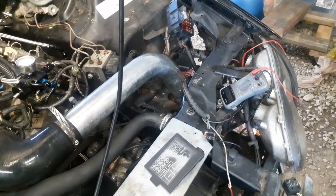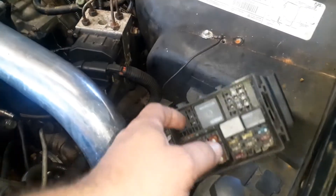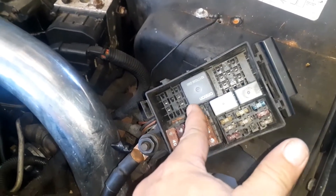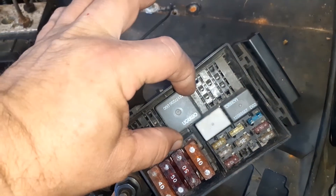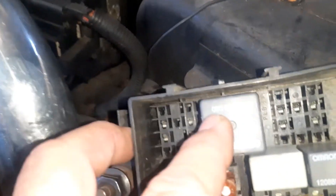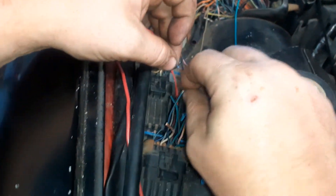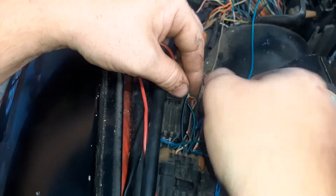We'll get it figured out. So we're still fighting with the fan. We checked for power here — this bottom one is the key-on power and that one worked. This one is the main battery power, that one worked. This relay works by: once you energize it, it connects these two, and then this wire comes out to the fan for the power, and then this one is the ground. When we grounded this one out and turned the fan on, it was pulsating — so the ground was the problem. The ground comes all the way around here and up to the H on this 10-pin black connector. He had a wire crimper in there and I don't think that wire crimper was working really good, because we grounded it out here and the fan came on.